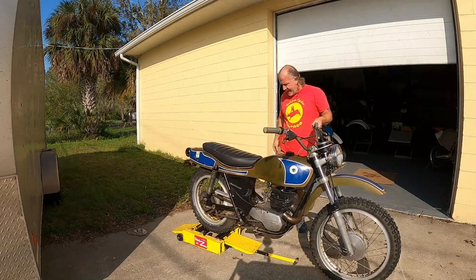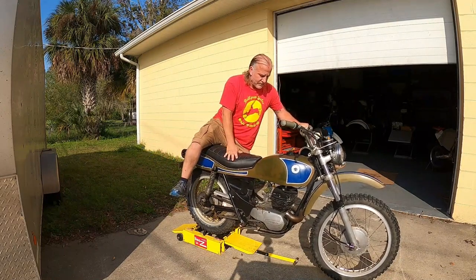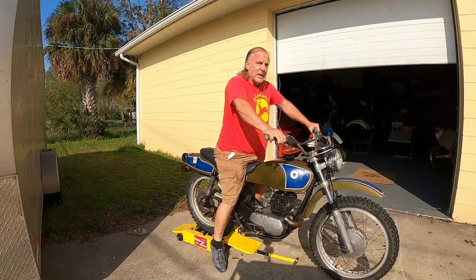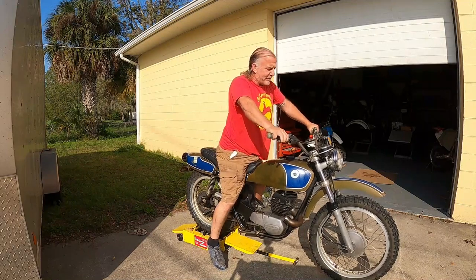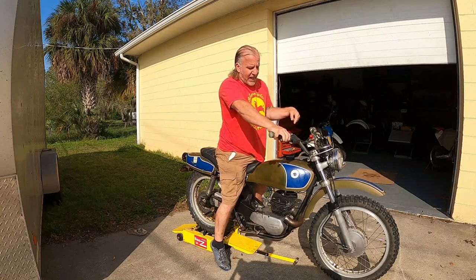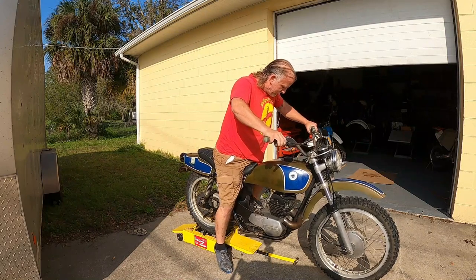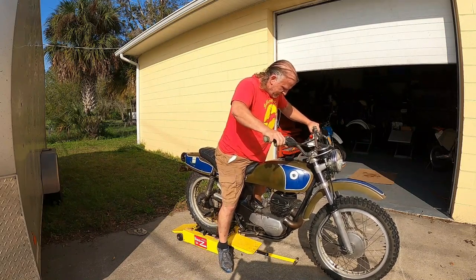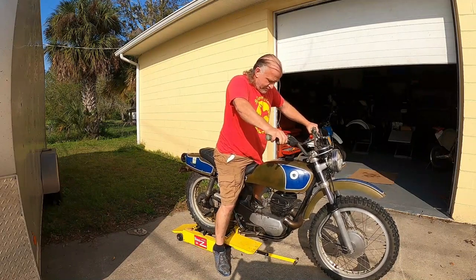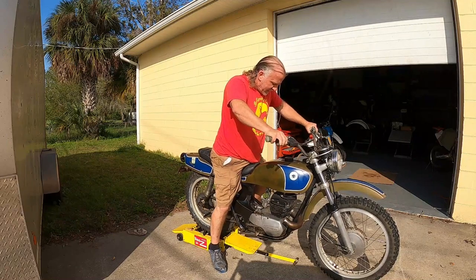The other thing you've got to do is start in third or fourth gear. These aren't really good for starting flat track bikes because without a front brake you can't hold the bike into the paddock — you almost need two people. It's still a little awkward, and you've got to sit far back and try to keep traction in the spool.